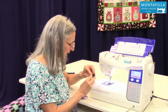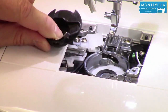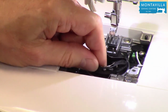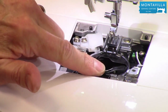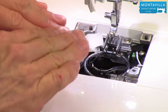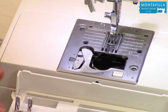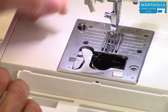To put it back together, this little knob is going to go to the left of that stopper — that's how you know you've got it the correct way. Scoop it underneath the feed dogs and drop it down like that. It is possible to get it in the wrong way, so make sure it's right next to the stopper. I usually like to rock it back and forth to make sure it's sitting down on the rim of the hook area. By the way, your machine does not need to be oiled.